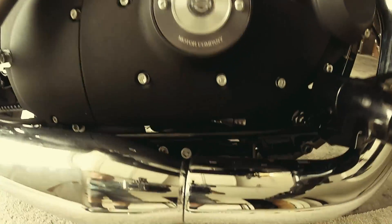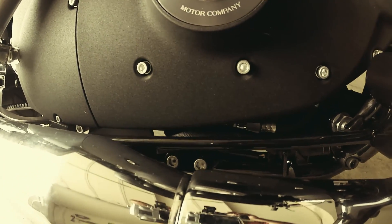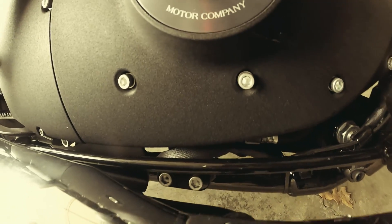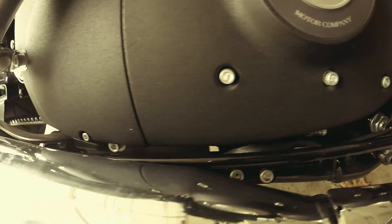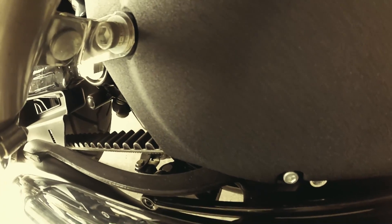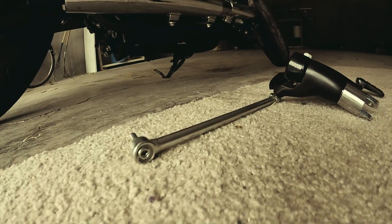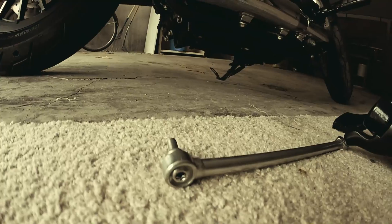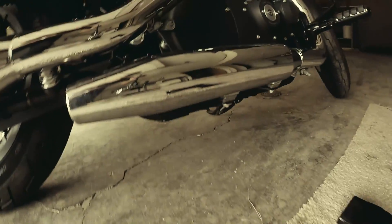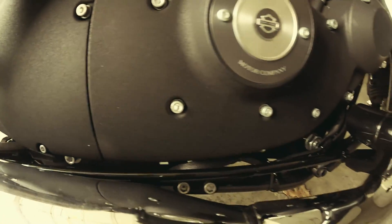The mid controls were mounted there, and those bolts were removed fairly easily. The challenge I had with removing this side was back here in the brake linkage — it's hard to see from here. This is what the stock piece looks like. The linkage is here, and this bolt is on with Loctite. I needed to heat it with a heat gun for about 30 seconds, and then remove it fairly easily from there.